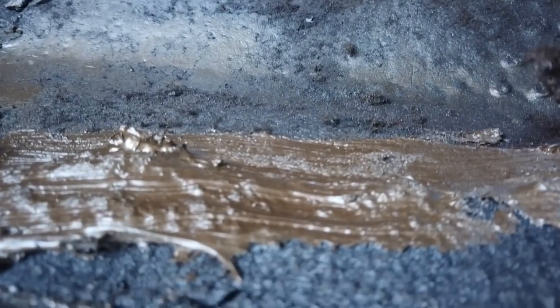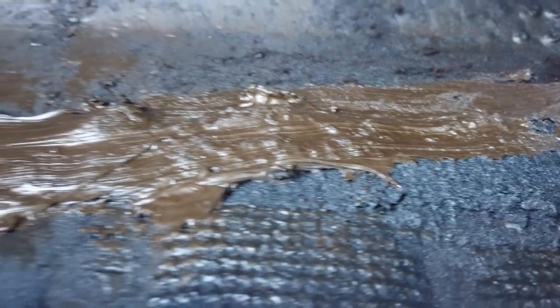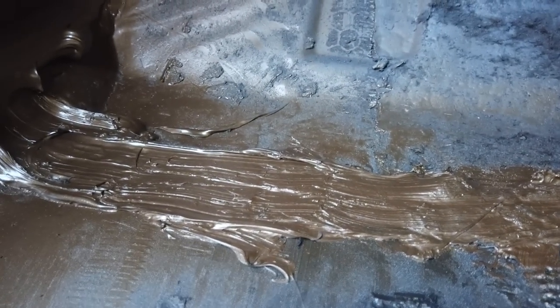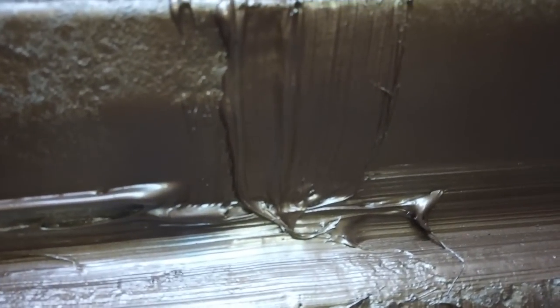So you may as well do it. Here the seam brush goes over. I'll just drag that back because I'm cutting that sound pad out on a neat square line. So I'll redo that little bit, but I just wanted to get this main area to lock it all in. There was no point filling that inner seal, so it was flush. So all I did was brush that over the seam seal. It was very neat, so you could have skimmed that. So that's it. That bit's done.